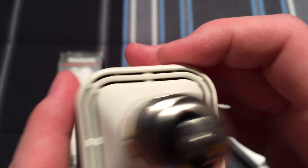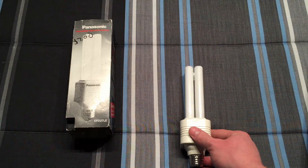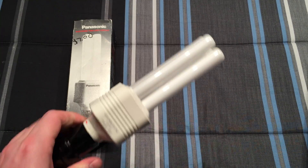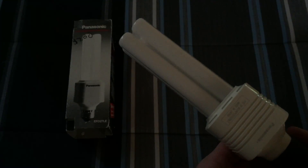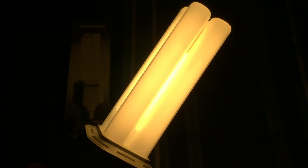Really nice and well-built bulb. I think I've only turned it on once just to make sure it actually worked. Let's go ahead and turn it on for all of you. Turn off our main light and let's give this nice old electronically ballasted CFL a whirl. It's going to take a little bit to warm up, because it's got to reach all the tubes with its mercury vapor. I see a little bit of end blackening there — that's pretty common on these older CFLs, even when they're brand new. When it does get to full brightness it most definitely equals a 100 watt bulb, it'll just take a little time.